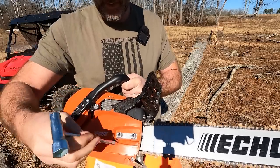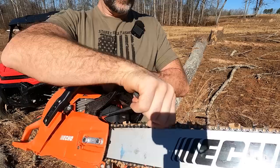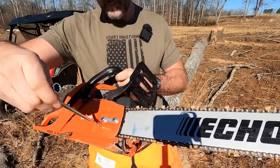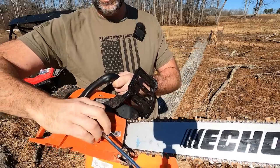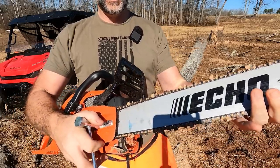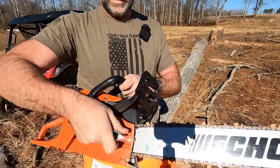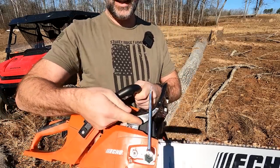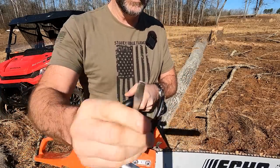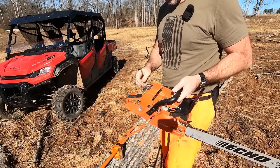Just loosen that guy up, tighten that down. We want a good pop. That wasn't quite a good pop. Let's see what we got. There we go, that's a good pop. Now, whenever I tighten my chain, I try to lift up on my bar just a little bit. Don't over-tighten these guys. A wise man told me, take your chainsaw wrench and cut it off right there, because that's all you need, except for the screwdriver portion, right? We're ready to rock and roll. We'll go ahead and start this saw and let it get warmed up.